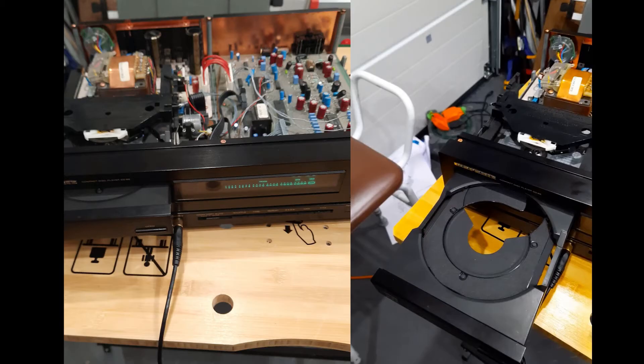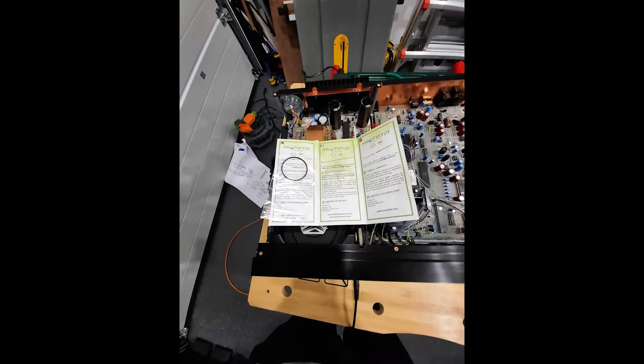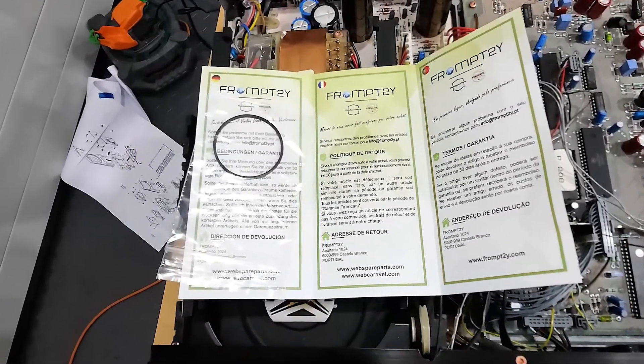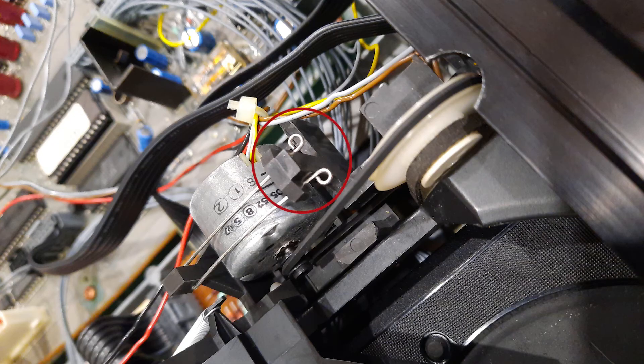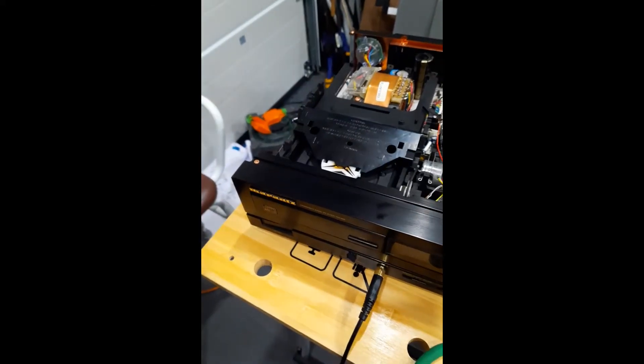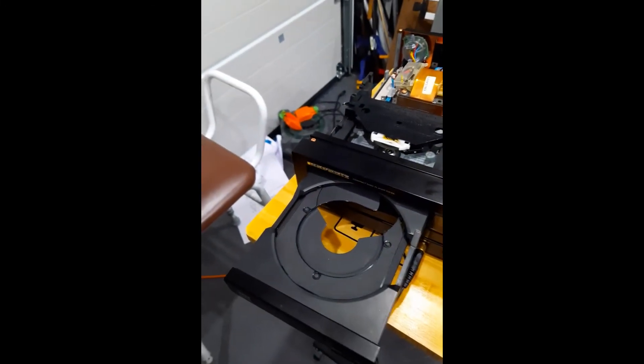With the power cord reconnected and safety ensured I turned my attention to the transport mechanism. After manually sliding out the tray and removing the CD I couldn't see any obvious problem, so I decided to go ahead and replace the belt with the one I had bought as a service item. While checking the CD mechanism I blew out any dust and cleaned the laser lens with some alcohol. To change the belt I unclipped the motor, moved it back, and checked it worked properly without the belt — replacing it was a bit trickier than anticipated and I had to very gently squeeze apart some of the plastic to slide the belt in, with some anxiety about breaking anything. Thankfully everything went back together and the mechanism was restored to full functionality.